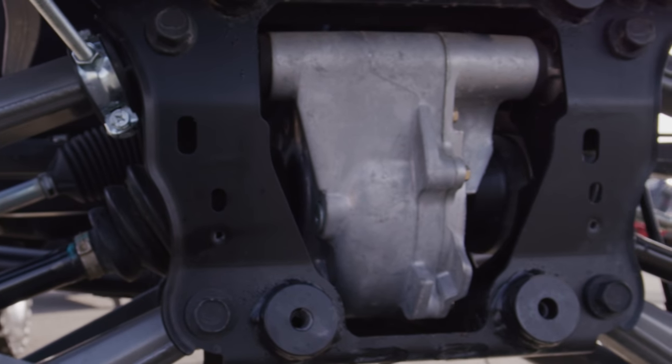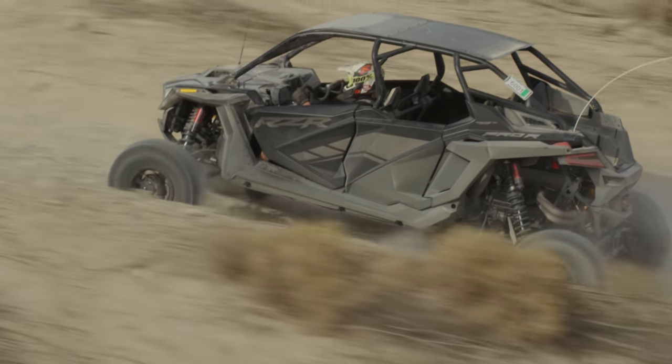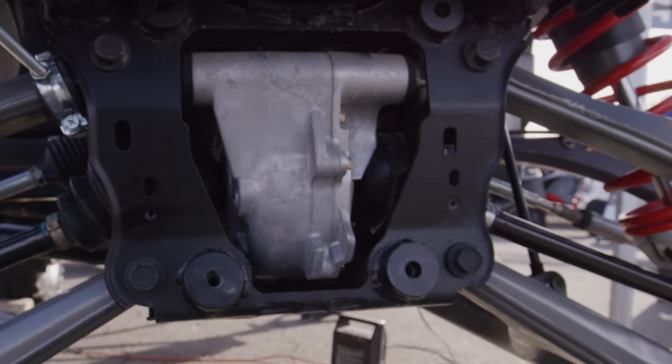Power and strength extend through the transfer case with larger drivelines, larger prop shafts, and larger rear and front differentials. A new four-wheel drive assembly gives three adjustments: two-wheel drive, four-wheel drive open, and four-wheel drive locked. In locked mode, both front tires spin at the same rate simultaneously. In previous Polaris models, the front drive assembly would engage shortly after the rear tires moved — not so with the Pro R. In lock mode, the front engages exactly at the same moment as the rear for better acceleration and traction. The front and rear differentials are separated from the transmission case, with 410 ring and pinions that are the same front to rear — a true one-to-one ratio.